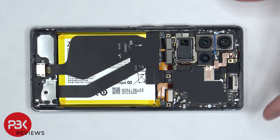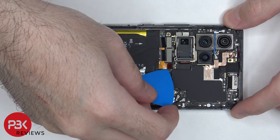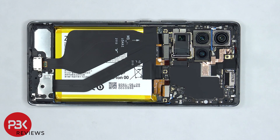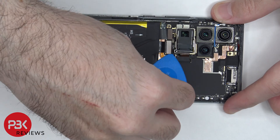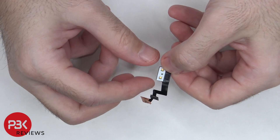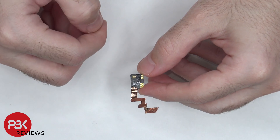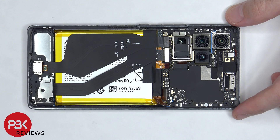At this point, there are two flex cables for the battery which need to be disconnected. Once the battery cables are disconnected, we can disconnect the rest of the cables. On the back of the LED flash flex cable, there's a secondary microphone which is this gold piece over here. There's some graphene film and copper tape covering the connector for the front facing camera, which needs to be peeled off.